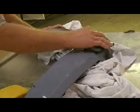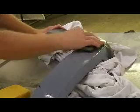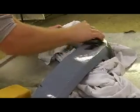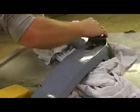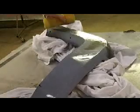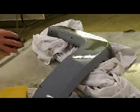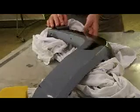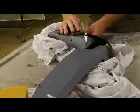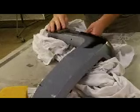I had a feeling that that might come back and haunt me, so I dusted it with some primer. Just one coat. You can hear the dry primer spray on that. I didn't back mask it, I gave up. Black's usually a color you can panel paint, and it is a fender flare. And we got plenty of paint.